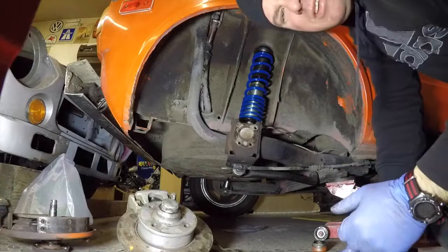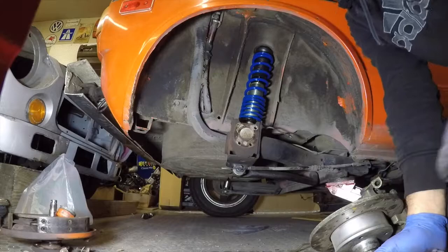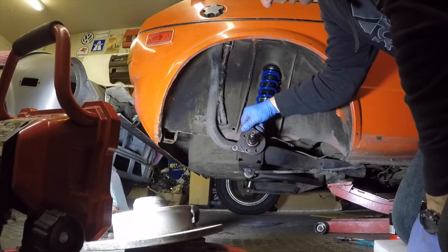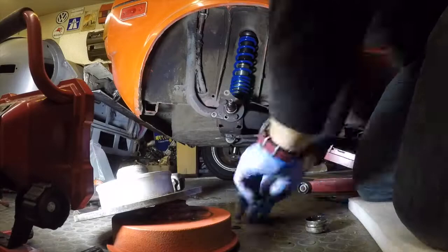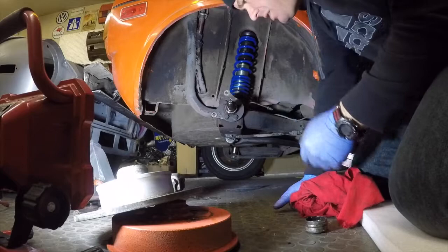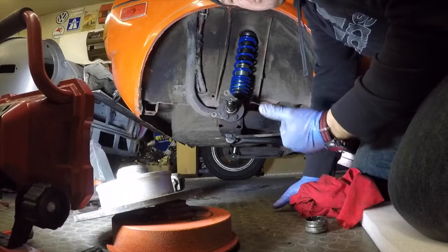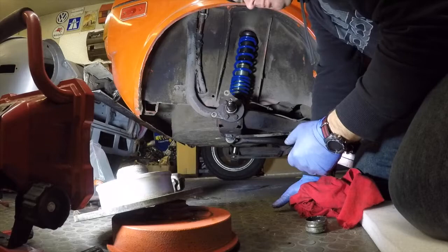And easy as that, we have a bare axle in the back. Now I'll take this disc brake assembly apart and put it together piece by piece. We've got the disc brake assembly apart — this is the stub axle, and it just bolts on right here. It's always a good idea to clean up the old grease and put on some fresh grease before we put the disc on, put the rotor on, and that'll be almost all of the conversion right there.